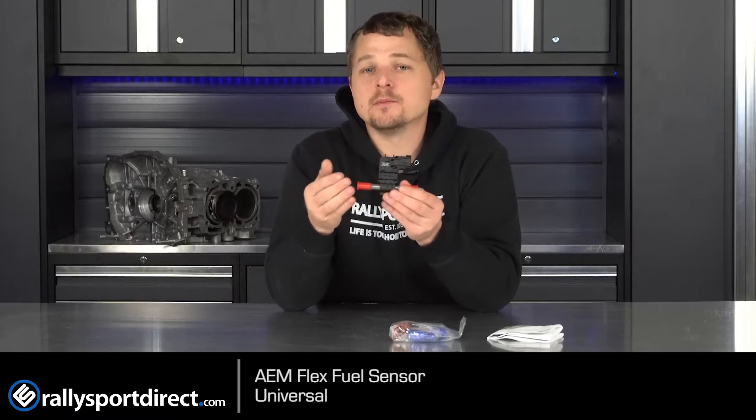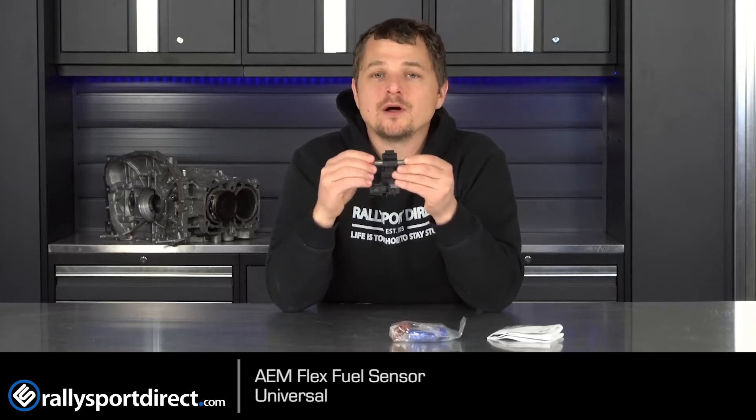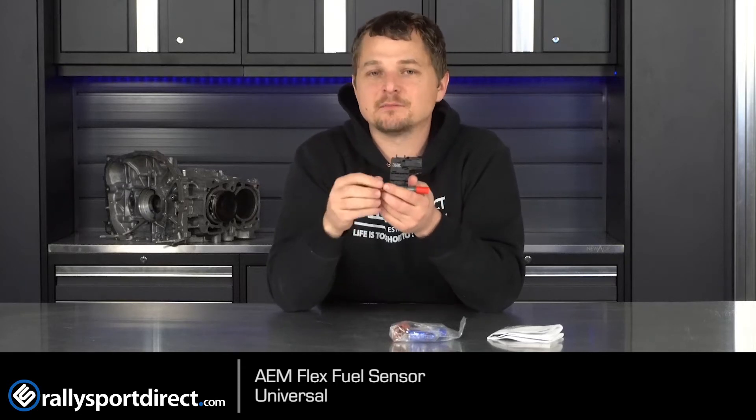The big reason this is huge is because even though you might have access to E85, you could go to the pump one day and get E60 — meaning 60% ethanol — and then the next day it could be all the way up to E90, meaning 90% ethanol. You truly have no idea. So this basically protects your engine and allows you to get the most power possible from your tune while keeping everything safe. When you get a tune with a flex fuel sensor like this, they can tune it from normal pump fuel — say 93 octane with about 10% ethanol — all the way up to E100 if you prefer.